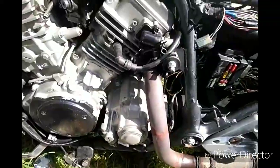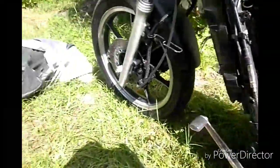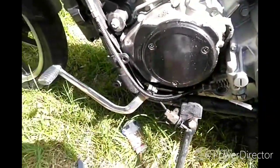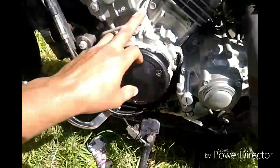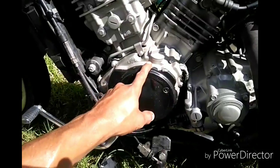I was having some issues with the battery, and I thought my battery was bad, but it wasn't. I tested the stator — put it in ohms — and it was crossed. It was making contact somehow.